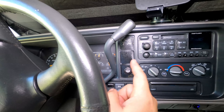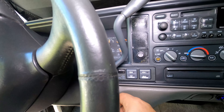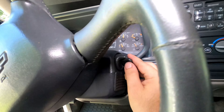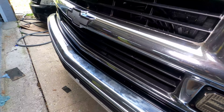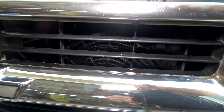Here's my switch in the dash in the 3D-printed panel that I made. As you can see it's in the on position, but the fan isn't running because the switch gets its power from a keyed ignition source. As soon as we turn that on... the fan runs.